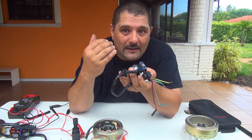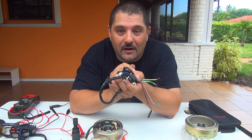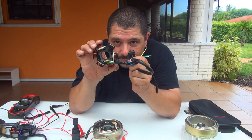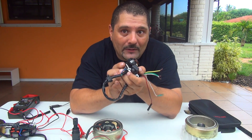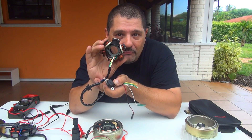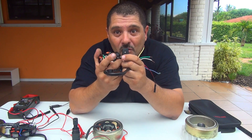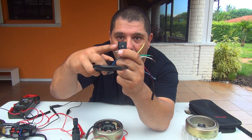If you're talking about an Italian scooter or a Vespa they might charge you a lot of money — about $400 for the stator with the pickup and everything. Yes, the stator from a Vespa will last a lot longer, but this one is not really bad. From what you pay for it you get a lot for your money. The main reason your spark plug is not firing many times is just the little sensor.